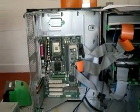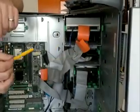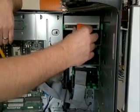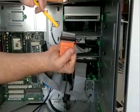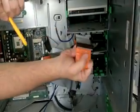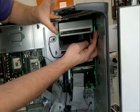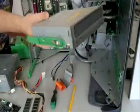Number eight, our DVD player. We've already moved the power cable when we took out the power supply. So we have one small cable here that transmits sound to the sound card, and we have our data cable here. There's a tab of orange that we pull to release that cable — it has a small indentation meaning it can only go back in one direction, so you can't place it in wrong. To release the actual unit, there are two green levers that need to be pressed together and the unit slides out. That's our DVD player.